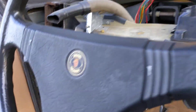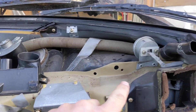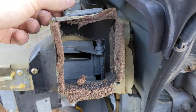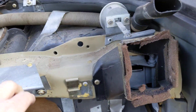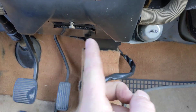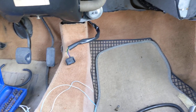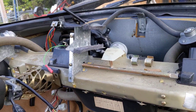Only Saab would think: hey, there's a big hollow beam — you know what we could do with this hollow beam? We could run the HVAC through the hollow tube so that we don't have to run ducting in the car. You can see the vents with the flap little vacuum pots. They used it for the left and right air vents, as well as the air plenum that distributes the heat and air to the floor left and right, and the tube that goes underneath the seats for the floor heat from behind for the rear passenger. They actually utilized this tube for the purpose of distributing the air.